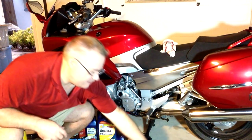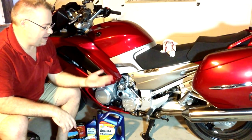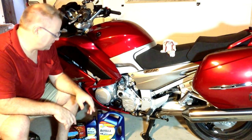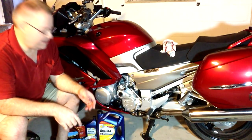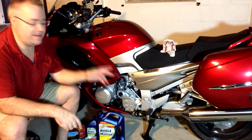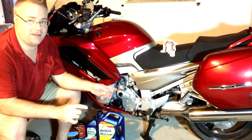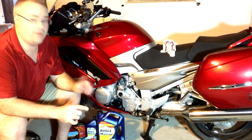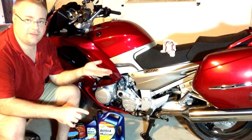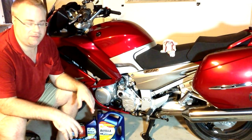Two more things. One, you obviously need your drain pan — what size depends on your bike. I have plenty of clearance and I can fit a normal car drain pan in here, no problem. I have a center stand, and the bike must be level — absolutely has to be level. That's what the center stand is for. If you have a sport bike, you're going to need axle stands. You cannot do this on the side stand; the engine is tilted, the oil does not drain or fill correctly. If you have a cruiser, get yourself a lift — they're not that expensive.